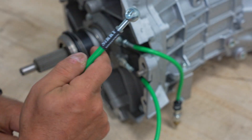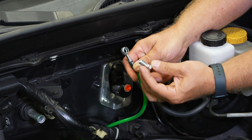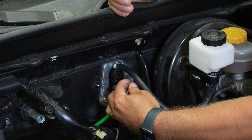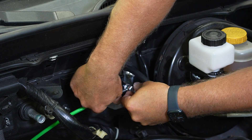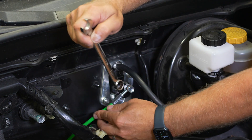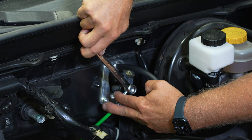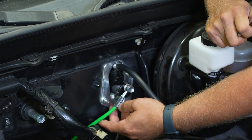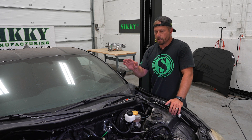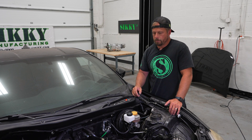All right, so the last step in this clutch master install is going to be taking the line coming from your slave cylinder, using the provided banjo bolt and banjo fitting. Make sure you've got the washers on both sides. You're going to pull this plug out — hopefully you listened earlier and did the bench bleed. Get this installed, make sure you start it and get it hand tight. You've got to be careful tightening this fitting down — not to over-tighten it. Route this line however appropriate to have clearance and not hit anything. Get it tight and then go about a quarter to an eighth turn — you're just crushing these two crush washers slightly. Doesn't take a lot of force and then your line's installed. So the very last step is just bleed the clutch system out and then make sure you check your pedal free play. You're going to want a little bit of travel of that pedal before it actually starts to engage the clutch master, because you don't want to be driving around with pressure on your throwout bearing. Pretty basic install — the hardest part about it is cutting the hole in the firewall, but I wouldn't be intimidated by this install by any stretch.